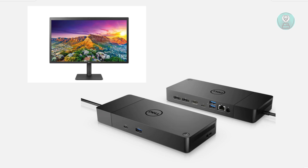So if you're having problems with your USB-C docking station not detecting your monitors, there are a few things you may want to do. First things first, you want to make sure that your docking station is getting enough power. If you have your docking station connected to an extension cord, you may want to connect the charger directly into a power outlet, because sometimes the extension cord may not provide enough power, which is why your monitor is not being detected.